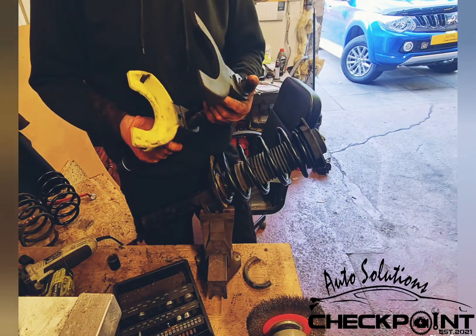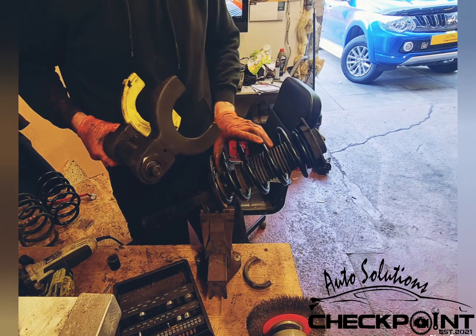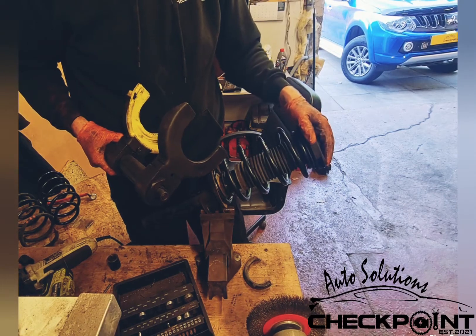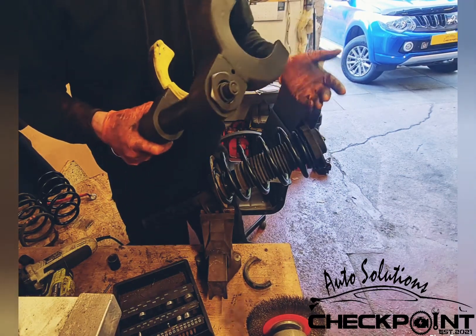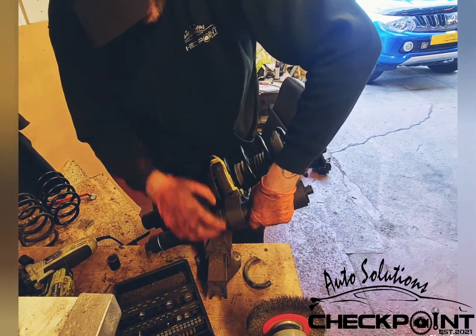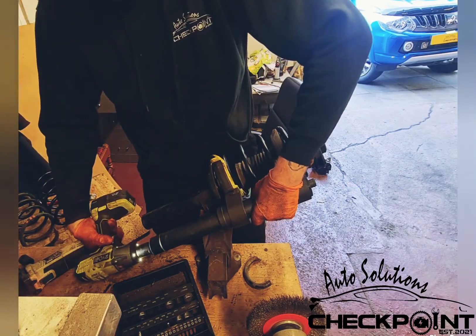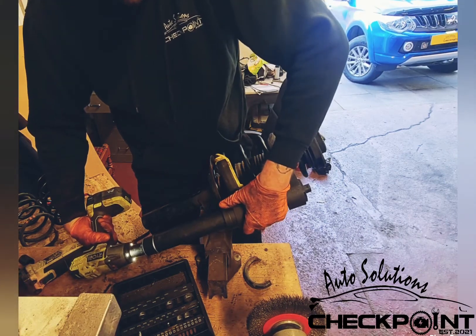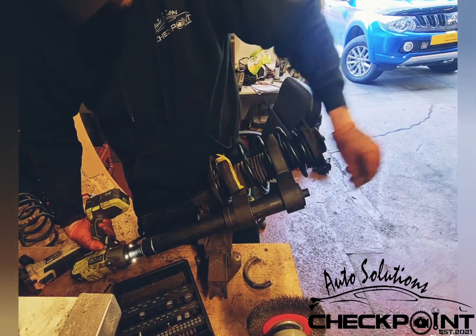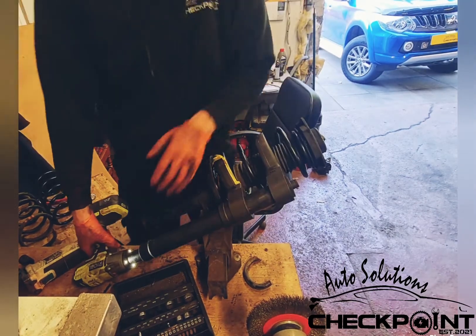They're a lot more safer to use than the more conventional ones. Basically you're wanting to clamp these three coils — you don't want to be too close to the edge, it's not going to work. Get in at the side, you should have a bit of leverage here. Get your buzz gun — if you don't have a buzz gun, use a ratchet. Here we go, ready to zap it.